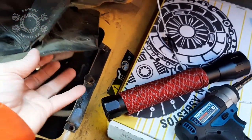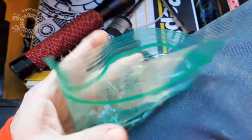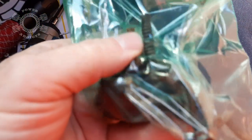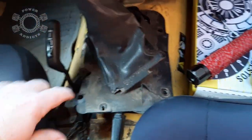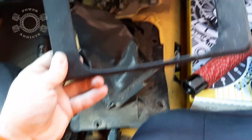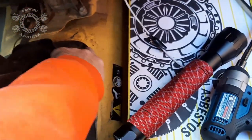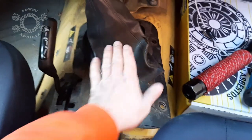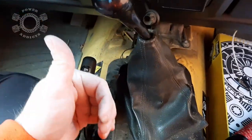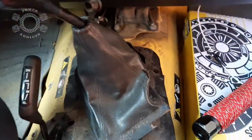I got the console out before I thought about pulling up the camera. Going around the console you're gonna have 10-millimeter screws right here. I'm using my little baggie to track them — wrote 'console' on there so I keep track of all the screws. Got three right there, then right along here in the console itself you got one underneath the shift boot. You gotta pull up the trim ring going around the six-speed shifter, and you're gonna see a bolt underneath that.